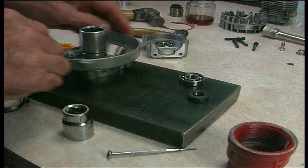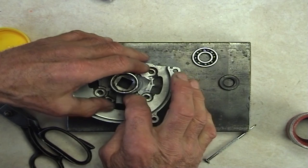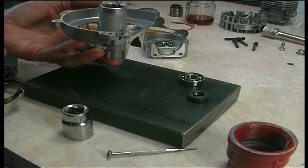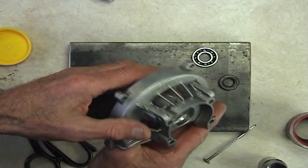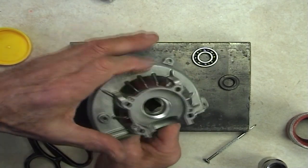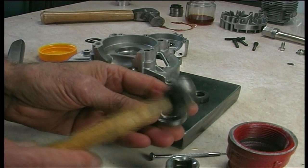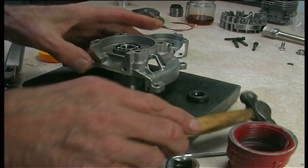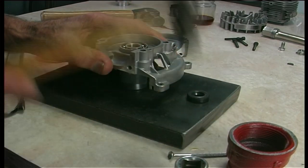It'd be all right if you had an extra pair of hands, but most of the time we prefer to work on our own so we have to make do. There's your socket held in place — can't slip off readily. When you look in there you'll see the socket is quite central, so the load when you hit it is only going to the diameter of the bearing. Same process: small hammer. Outside of bearing, inside of bearing — that's facing inward. Place him on there, just get it press-started by finger.